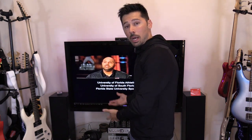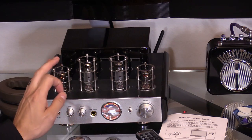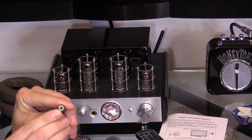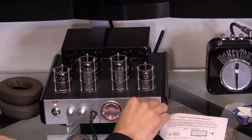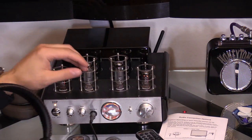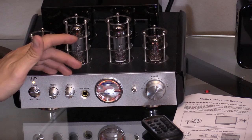If you have an amplifier receiver, you can connect your headset to that as well. On my amplifier there's a headphone output — it's a 6.3 millimeter port with a 3.5 millimeter adapter. Plug the 3.5 millimeter audio cable into that, then plug in the power cable and turn it on. Raise the volume on the amplifier to increase headset volume. I like to keep the amplifier volume around 50 percent and adjust the headset volume controls from there.